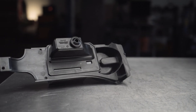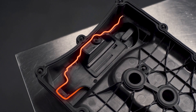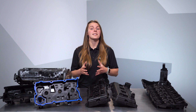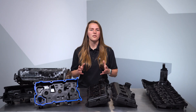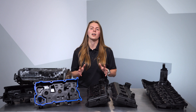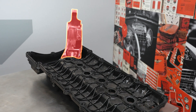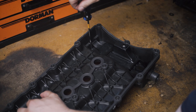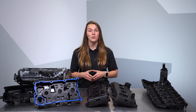While we're on the topic of PCV systems, let's talk about an interesting OE fix we developed for a number of Volkswagen and Audi engines. On some 3.6-liter engines, the OEM PCV valve is integrated directly into the valve cover, and the OE doesn't sell just the valve — one must buy the entire cover should the PCV valve need replacing. What was once a few-dollar item replaced at normal tune-up intervals has now become a very expensive repair requiring a whole valve cover swap. Our OE fix includes just a fresh valve cover gasket, spark plug tube seals, and a new crankcase ventilation valve. All the tech needs to do is remove the valve cover, flip it over, remove the old valve, and swap ours in — and the old valve cover can be put back into service without the large bill.